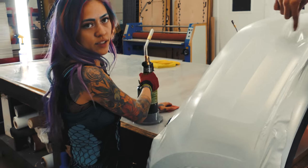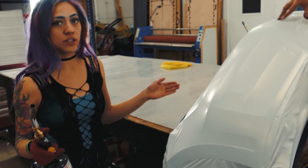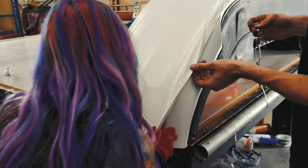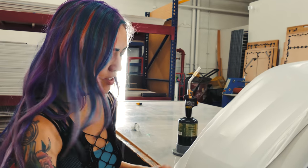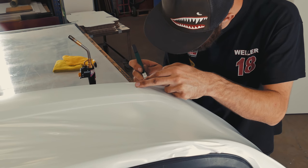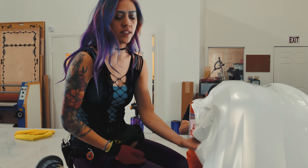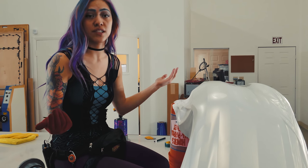I always try to hit the biggest recess areas first. Any areas you have to actually stretch, hit those and try to go in one go because this material is very time sensitive — hit all the hard areas first, stretch those, then work out. Also avoid pulling the material up; when you pull up like that you can create adhesive lines, so be really careful with that. Now that I'm to the edge and heating it, it's actually going to relieve the material. So I'm just going to work it around the edge about a quarter to a half inch, and then it's never going to fail — you're never going to see it peeling up.